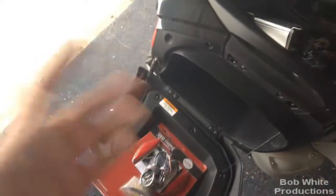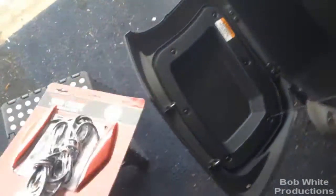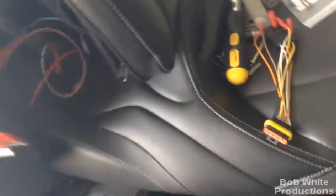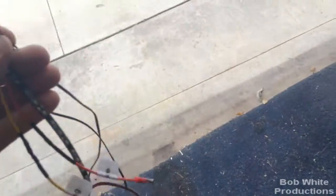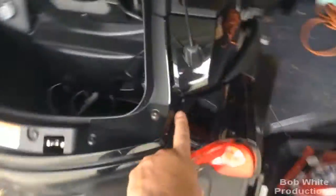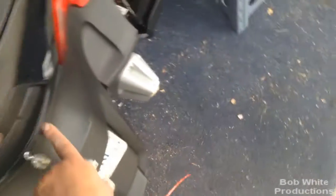Today we're going to add some more Farkle — adding the rear running and turn lights onto the chrome area, the same kind of thing we did on the front fender. We'll use a heat gun to pry the old ones off and wire them in. I also have the third and fourth brake light kit from Show Chrome. The long brake light goes around the lip here, and the fourth brake light goes under here.